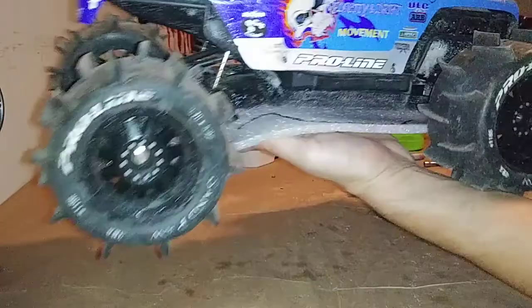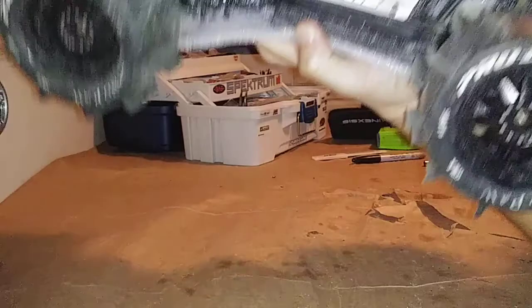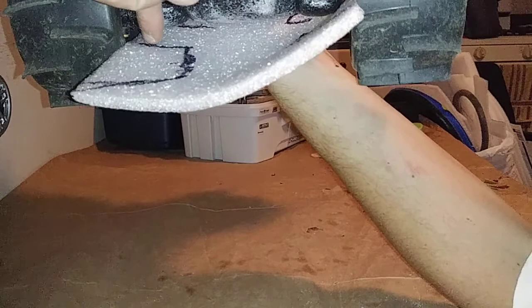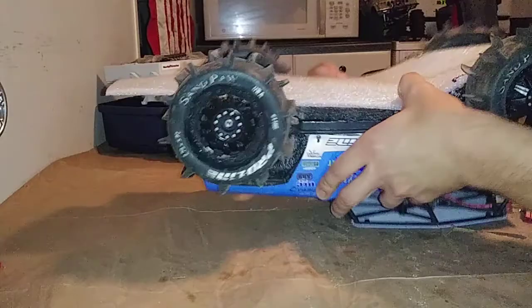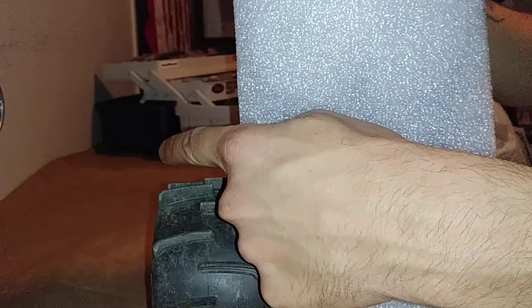While it was sitting like this I took a Sharpie and basically traced out the entire chassis and belly pan - right along in here, somewhat traced out the A-arms on the front, traced out where the A-arm is from the edge of the tire, and brought it back on an angle to allow the tires to turn. So it's going to be slightly fatter on the inside and then taper in as it goes. I also made marks on the back where I need to cut out to allow clearance for the back tires.